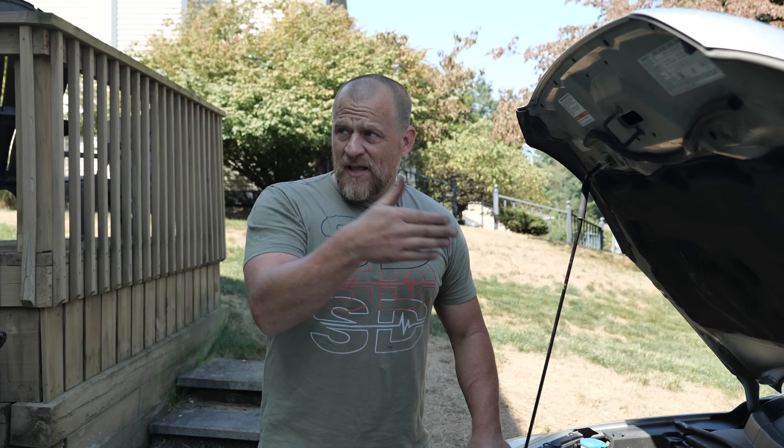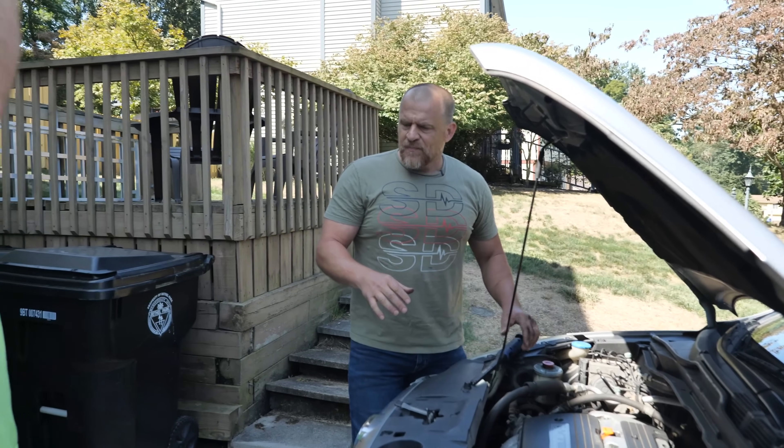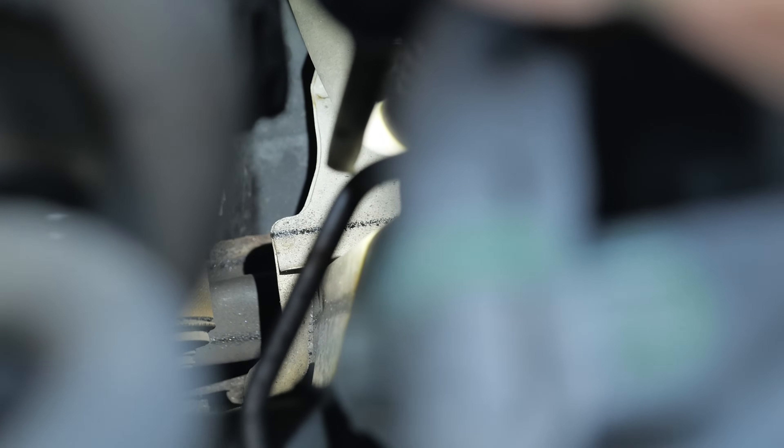One of the things we look for is alternator and things like that. I need something long and metal I can put to my ear as a stethoscope — a long screwdriver or something like that. I smell something electrical, and I also see those black lines that look like they're coming off of the AC compressor. There are actually two lines — one on the radiator support and one just inside of it. That might be the clutch that burned up on the AC compressor — a clutch bearing noise on the AC compressor itself is what I think is possible here.